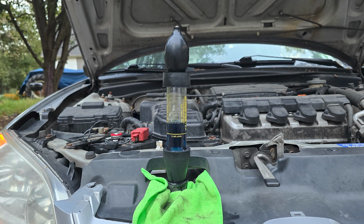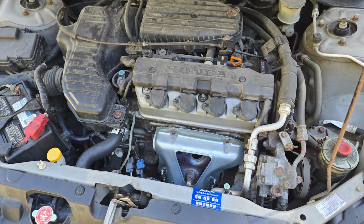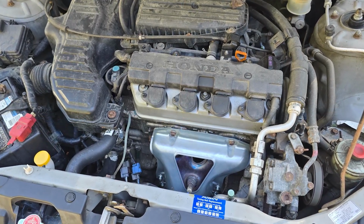Didn't diagnose a head gasket originally, but realized that it probably was. A lot of times those 1.7s don't show in the little coolant pressure tests and various things that you do with the combustion fluid that changes color. Nothing in the oil, nothing like that. What it seems to be doing, though, we finally were able to get some more data and information.